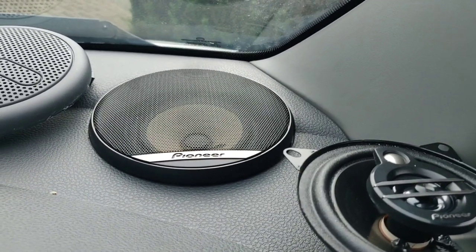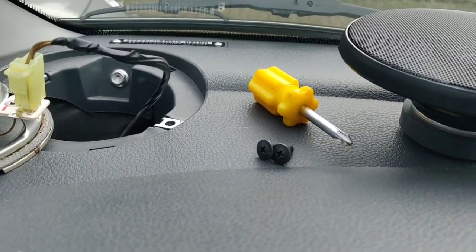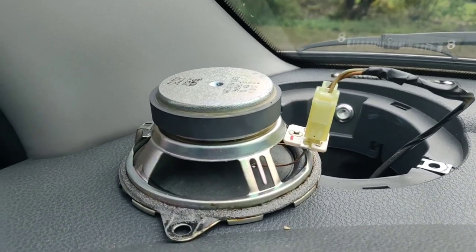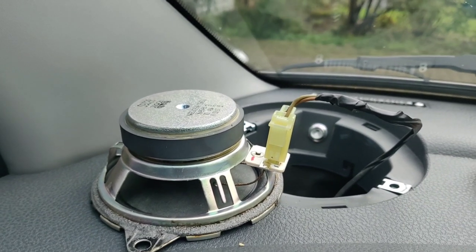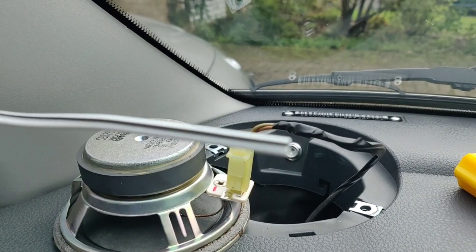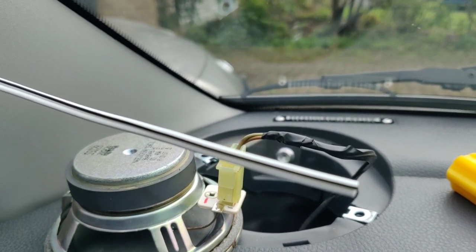It's going to be a wonderful replacement. Using my little stubby screwdriver, I've undone those two screws that hold the speaker in place. The only significant thing is that they have a specific connector on these speakers, but we're supplied with a couple of little pairs of stubbies which I can crimp on some new spades and adapt them - that's quite easy. I've got my little crimp kit here.